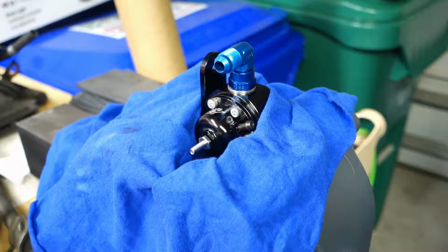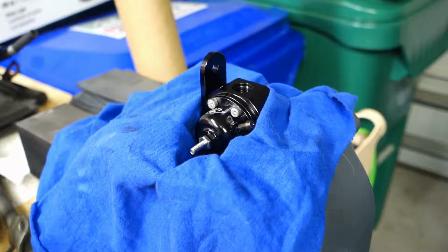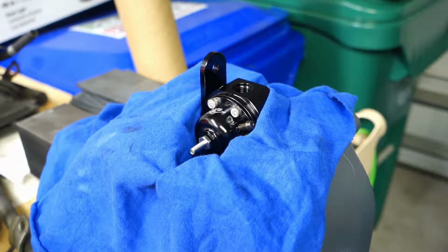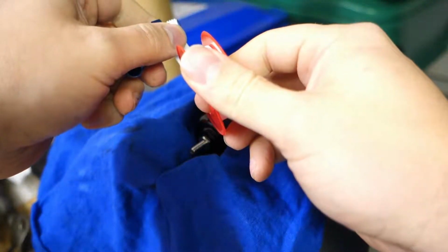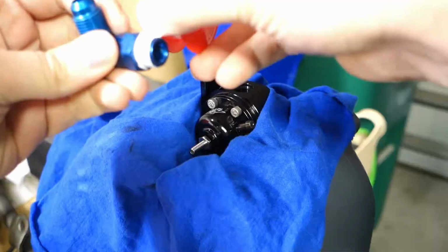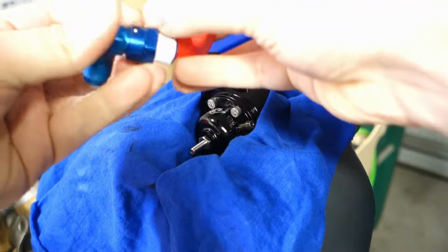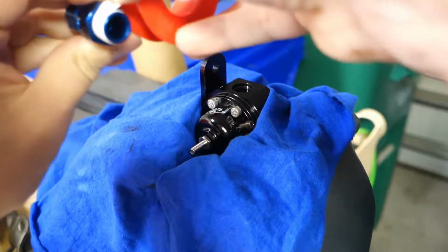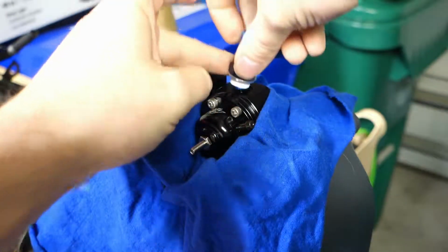I'm over here at the vise, getting ready to clamp on these ends. This is just set onto here. This isn't actually clamped. I'm just getting ready to do this. I have to put Teflon on these threads first. For doing the Teflon, it's going to go in a clockwise direction, so as you put it on there, it's not going to unravel. You want to go to a maximum of 1.5 wraps. So that was 1.5 to 2 turns. All right, crush washer on.